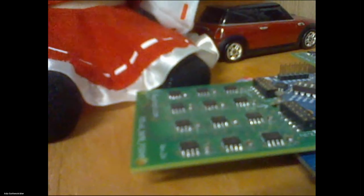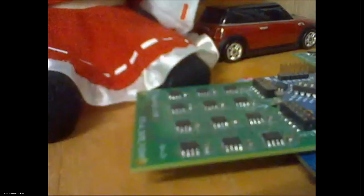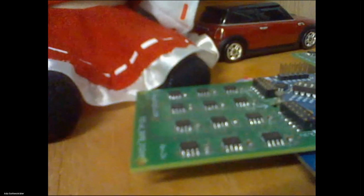If you like doing your web server thing, you could just copy all the files into the RAM drive. Yeah, I'm thinking about, for example, getting the web server root onto the RAM drive. Yeah, you can just load stuff onto the RAM drive, and then let it run from there. And no SD card slowdown. Just go from the RAM.